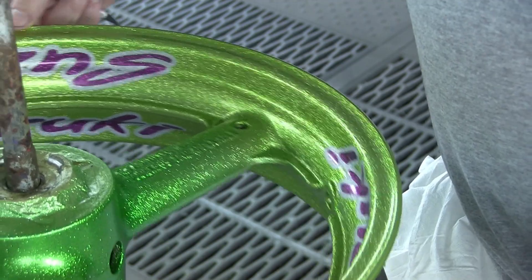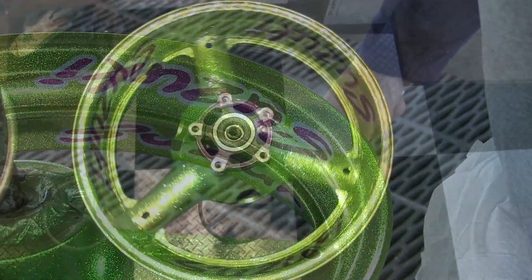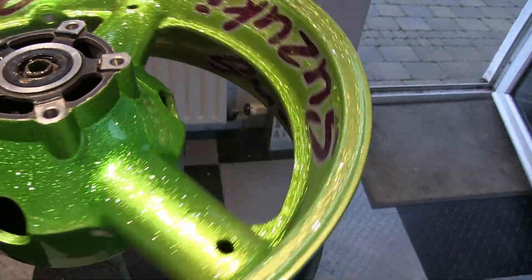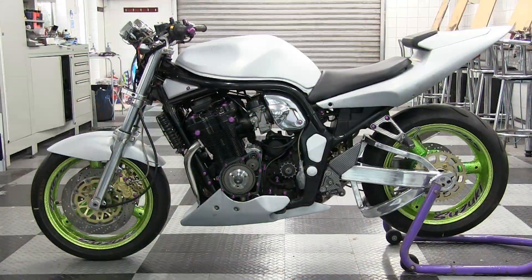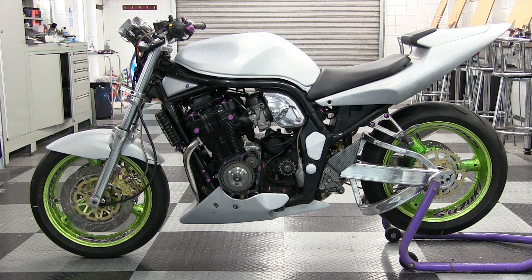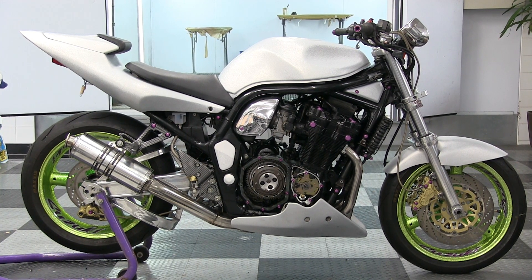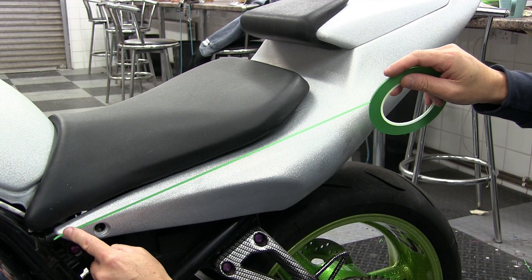This is the clear coat on the rims — I'm getting a little ahead here, but I'm showing you this because I want to get the bike into a rolling chassis so I can focus on showing you the techniques I used. Once I've got this cleared and built up again, I'm now going to mock up my bike on the main stand. My bike's a street fighter, so it's not so important with this style, but if this was a full plastic bike I really need all the plastic components touching and in situ so that when I come in with my fine line tape everything flows.